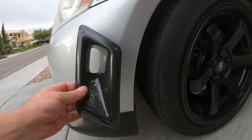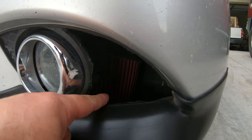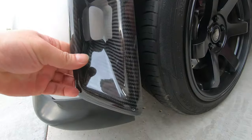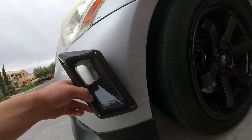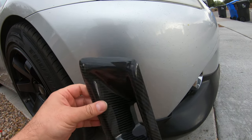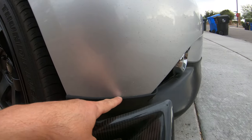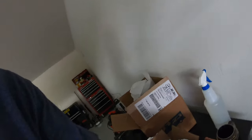I'm thinking of putting these bumper inserts here. The reason I'm doing it here is because my cold air intakes are right there. I did open this area up a while ago and I know that helped, but this is another spot where I think it'll help guide some air in. I'm thinking of orienting them like this rather than like this, because the surface is curved and I need them flatter. The bottom line follows this body line and the top follows the headlights, so I think this is the best spot.